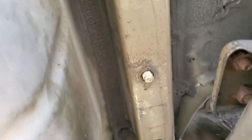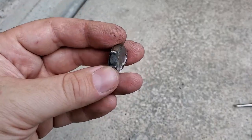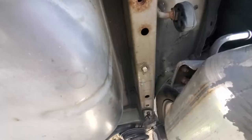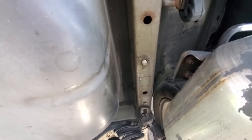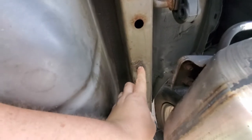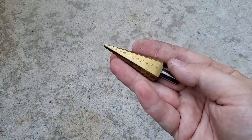I already cut the head off the broken bolt using my air grinder. You can use an electric grinder, but it's really hard to get into a tight place — the air tool worked perfectly in that tight spot. You can also cut with a saw, whatever you have, just cut the head off. Then you literally just push that bolt inside the frame, where it'll stay. Now I need to cut the hole bigger so my rivet nut will fit. I'm going to use step drill bits for a more precise hole — these run about $18 at Harbor Freight.